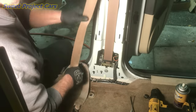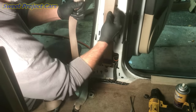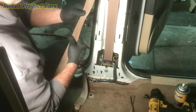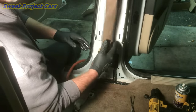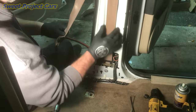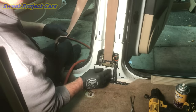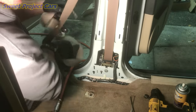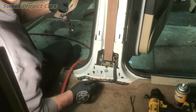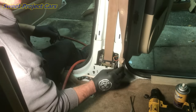As you can see, the belt only has so much room in here. This little ball bearing tells when the cog should set and catch — it's a little flipper-tooth thing. Dirt gets on this, so spray it down with some 99% alcohol, take your air nozzle or a computer keyboard sprayer, and blow some air on there to get it all cleaned up. That ball gets stuck and won't do what it's supposed to do — that's what actually makes it engage.